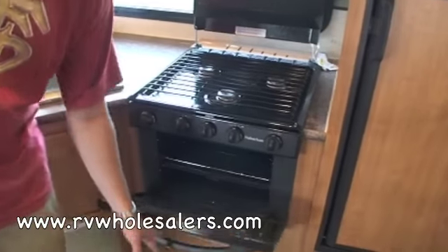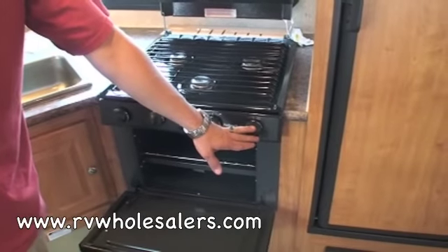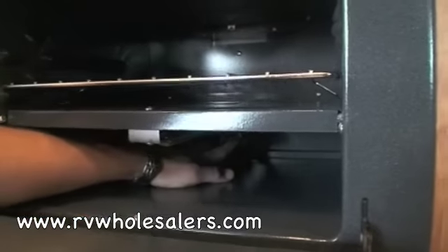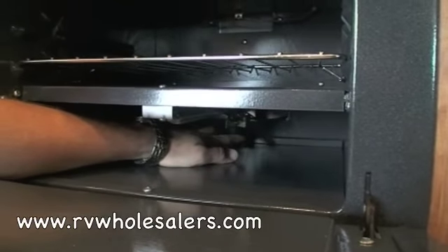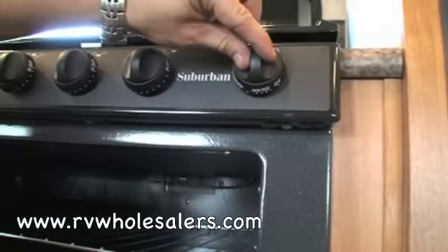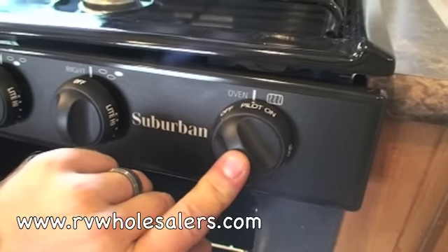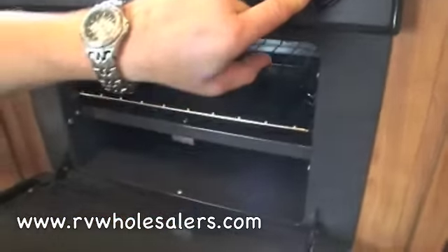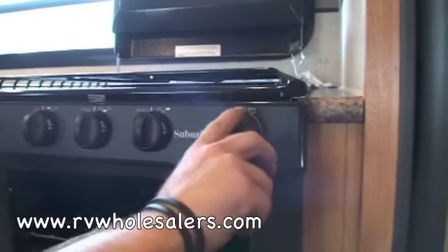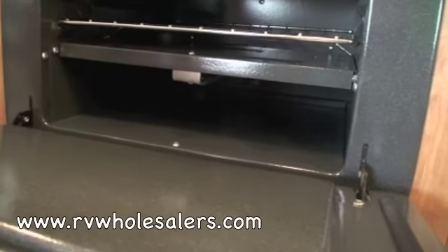The oven on the other hand is different — you have to light the oven by hand. This is the oven knob. The general rule is the same side the oven knob is on, the pilot light is on. So all the way to the bottom, all the way in the back is your pilot light assembly. You'll need a long stick lighter. You'll want to hold the lighter in that area, then push and hold in on the knob where it says pilot on. Push in and hold the button there as you light the pilot. As soon as the pilot lights you can release the knob. It'll stay burning and then you just twist the knob to whatever temperature you want. The whole rod will then light up with flame and you let it warm up until you get to whatever temperature you need.